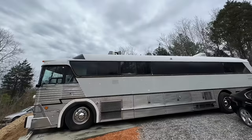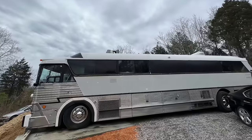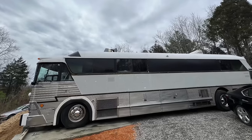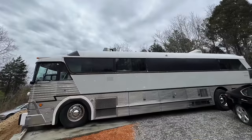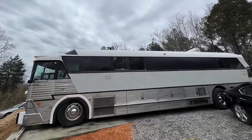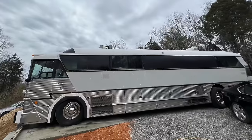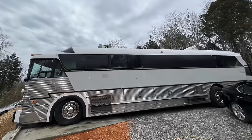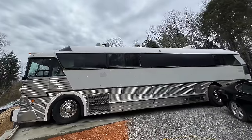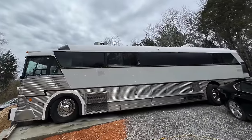We ordered a bunch of electrical parts, the breaker and stuff like that, and we'll get into that. Boy, that could be a whole big can of worms. It could just snowball into a huge bill. But not having the low air buzzer working, that's very dangerous. And then obviously the oil pressure gauge, we want to keep that going, because if you lose oil pressure, you're out a $20,000 engine or more. So we're going to make sure we get those basic things working and then let him figure out everything else on his own. But that's where we're at today, and we should have the parts in on like Tuesday or so.